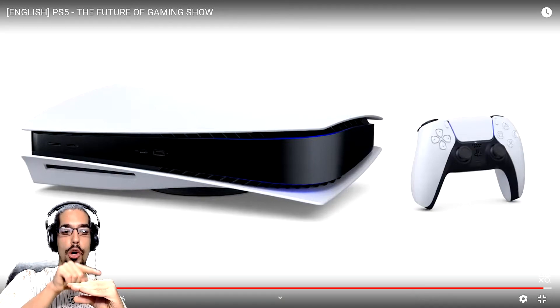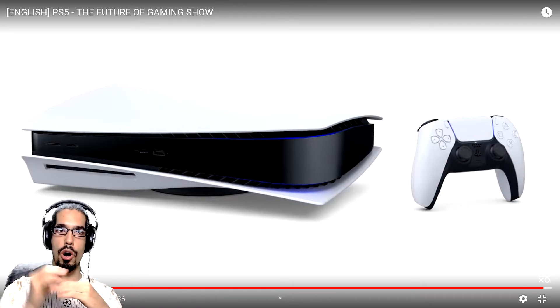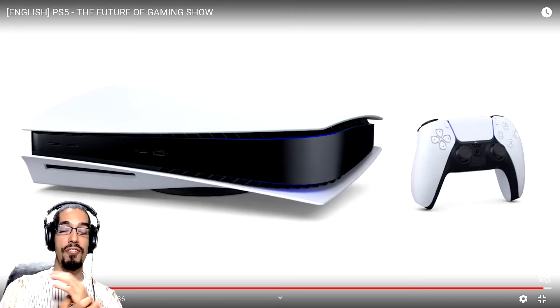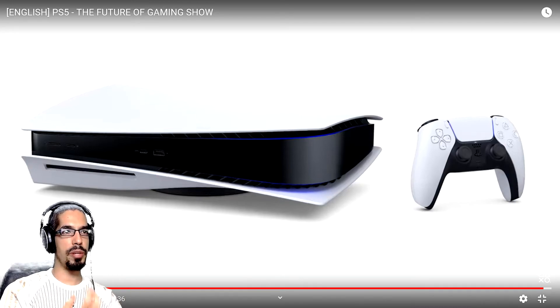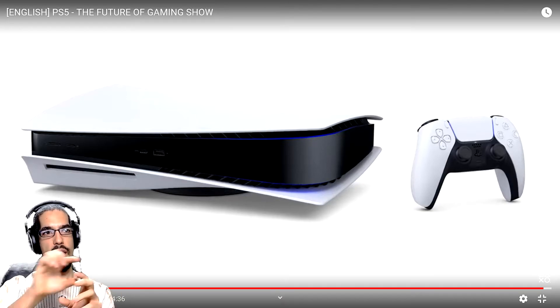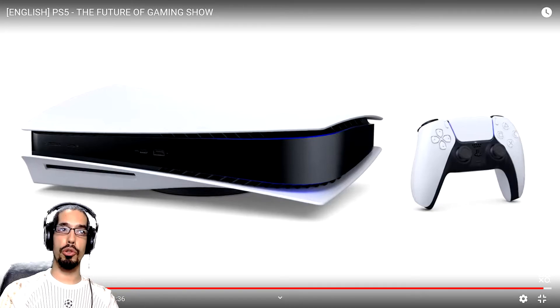Sony is using this horizontal presentation as a viable choice, which again is not — it's going to make the hot air travel a longer path to exit the chamber housing the hardware, and this is going to negatively affect the longevity of your console overall. So my recommendation is: if you buy this, use it tall — use it vertically. Do not use the horizontal orientation. The way it's placed, it's also hard to tell where the CPU and GPU are, because the closer they are to the ventilation exit, the better the heat dissipation will be.